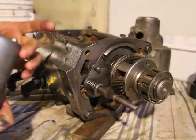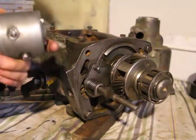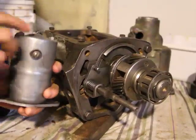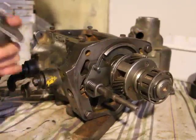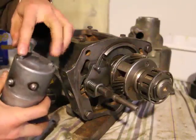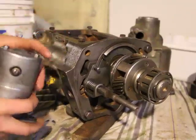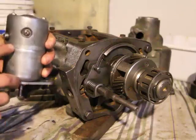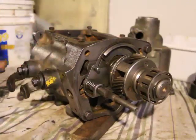But I mean, these you can use a hammer. You don't have to use a rubber hammer, because this thing is heavy and it's thick and it's very hard and very durable. So it's highly unlikely that you'll damage it. Although I did remove the cap and this comes out. This little piston, it does come out. Contact points will come out. The two posts here where these nuts are connected, they will come out. One of them unfortunately didn't come out. It's stuck, seized in there. The other one did come out, and you'll have to remove them. But I did work on all this, but I didn't work on the electromagnet side here, so I don't know the condition of the wires in here, and it's not so easy to remove them. Right, but anyway, that's for another video.